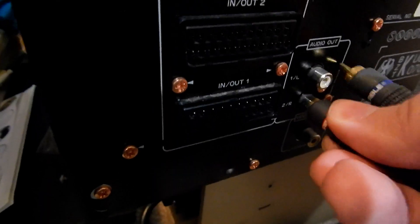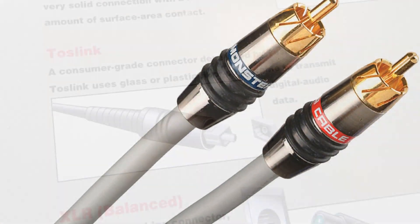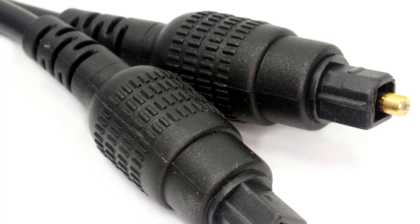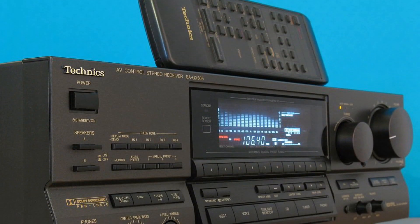If you want to check out something in stereo and you have an analog player, just hook up the audio outs and hope your disc has analog audio on it. If you have a digital-age player, you can do the same — it'll have those same two RCA analog outputs — or if you have a player with a Toslink optical digital out, you can use that to pump PCM CD-quality sound to a processor like a pre-pro or AVR that might handle the signal better.